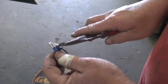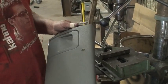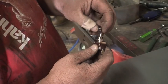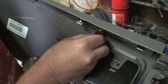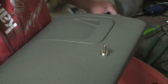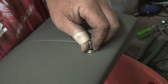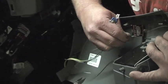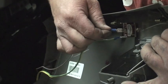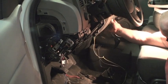Next we'll move inside the cab. We drilled a half-inch hole to install the control switch. This is a momentary-on switch for up and down, spring-loaded back to the center position. To make the switch operate properly as wired in this diagram, the green wire goes to the bottom screw on the back of the switch, and the yellow wire goes to the top screw. The ground wire from the battery lead at the motor goes to the center. In this particular application, the brown wire will be rerouted to the fuse box of the vehicle to a position that only has power when the ignition switch is turned on.